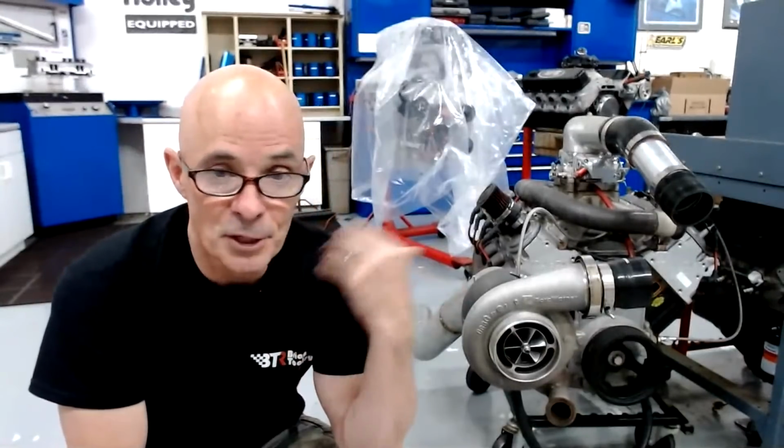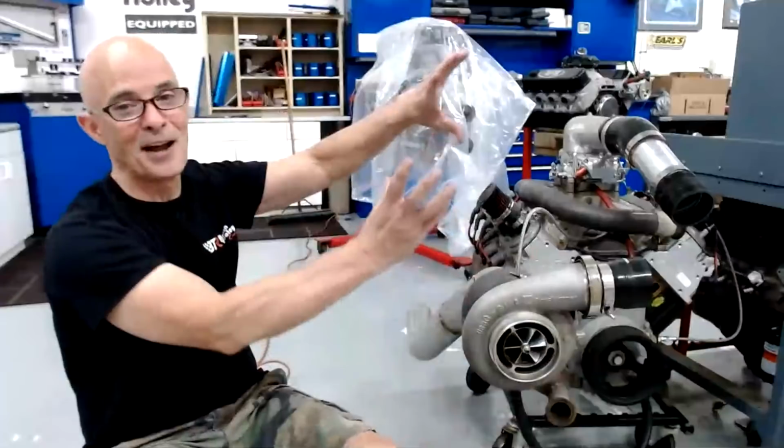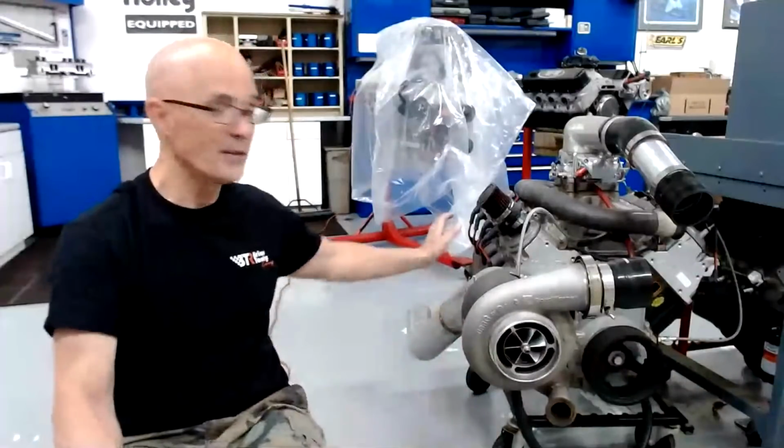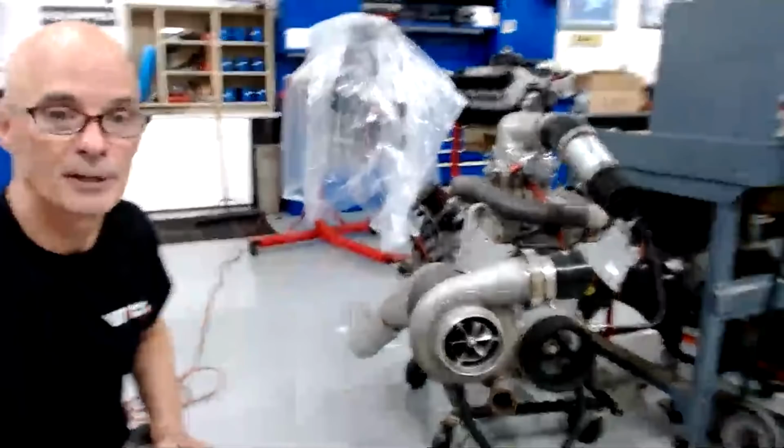it the most responsive. So big exhaust to get the most power out of it, and you don't want to choke it down from the exhaust. Now, on some street applications, you might want to run mufflers or dual exhaust or that kind of thing, and you can certainly do that. But that's why you see turbo guys running at the track, they've got the big 4.5 or 5 inch pipe coming out of the fender well. And the reason that they're doing that is because the turbo really likes a free-flowing exhaust system, which is why you can kind of see this one over here.